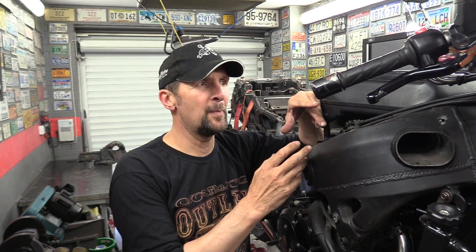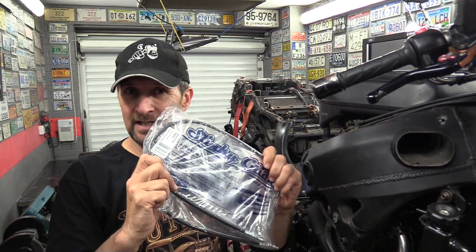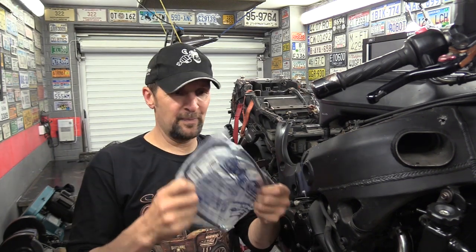And yes, you can oil it, and yes, you can lubricate them. But I've found in the past that 6 months down the line, they chew up again. Because whatever you put in there, it dries out over time, becomes sticky and slimy, and it's just never right. I've had so many good results with these Slinky Glide cables that, to be honest, for what they cost it's better off to just slap a set on there and forget about it.